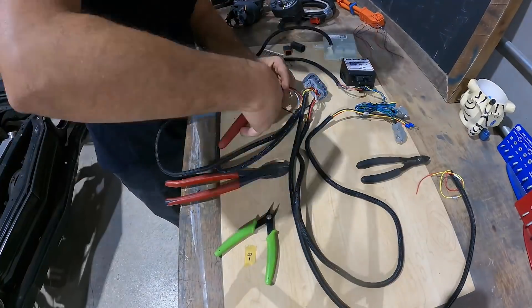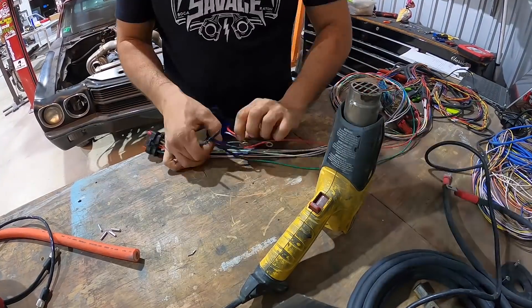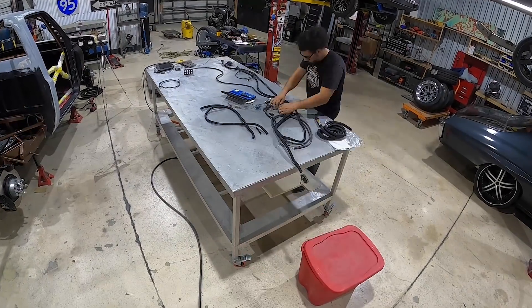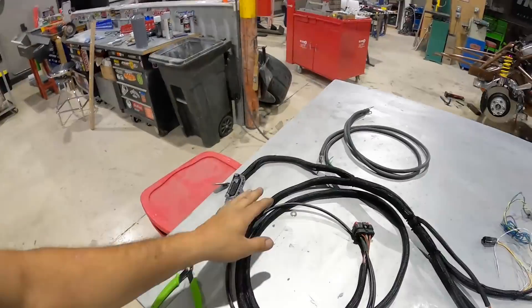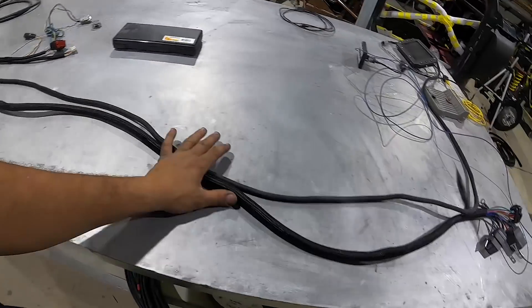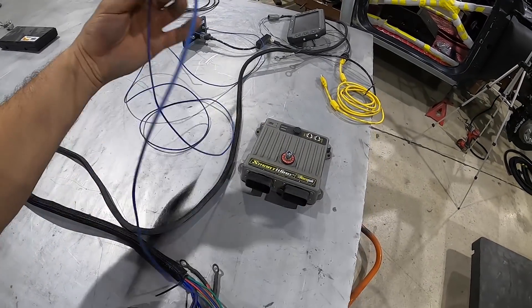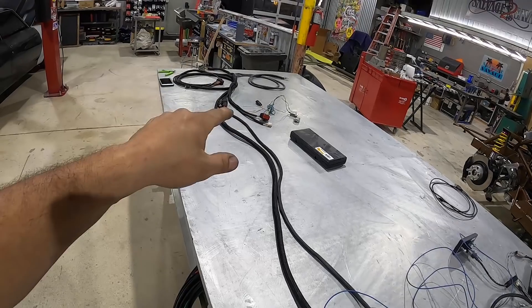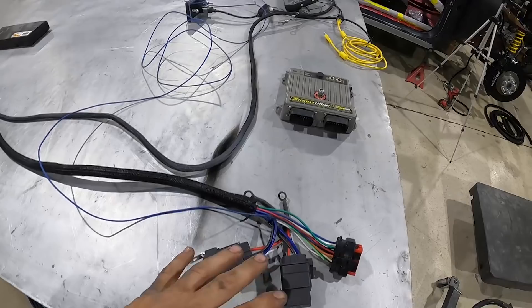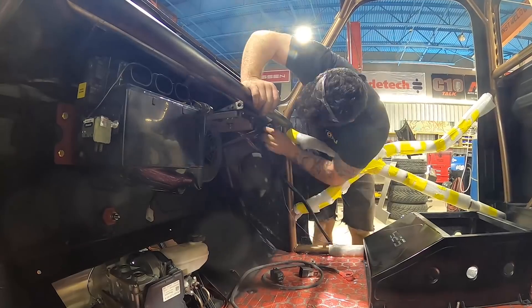Now that I've got the power cables ran into the vehicle, I can start mapping out my body harness and everything that's going to run up to the smart wire. I just finished looming up our main harness that's going to power the rear motor and control the battery. There's also going to be a second harness running to the front. We're utilizing a Race Pack smart wire for all of our switching. There were a couple of pull-to-grounds we needed for the rear motor, and since the smart wire only outputs 12 volt power, I used a relay to switch it to a ground. The wire loom we're using is Holley brand — their Holley EFI braided loom.